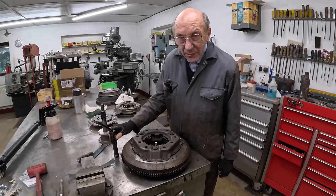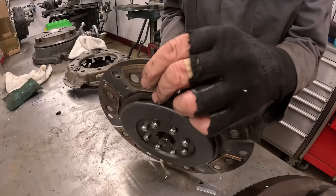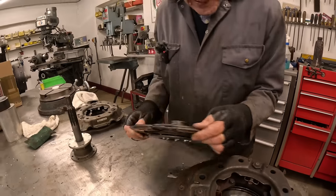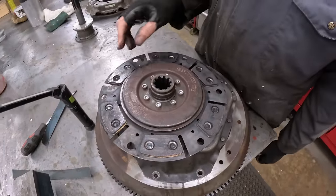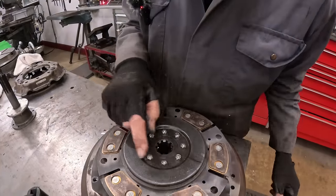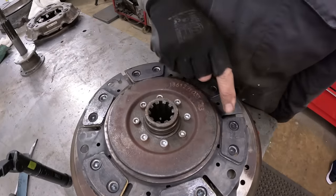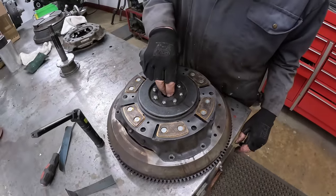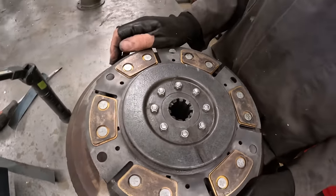And then previously we thought the clutch was slipping because it might be being held off by the spline. So we went to a load of trouble of making sure that was lovely, and it is lovely, so that ain't that. These came from America. They're sintered pads. So I took the lining off and put the sintered pads on, and they are about the same thickness as the original lining. But as you can see, look, this side is hardly used, where I think the oil might have been, and that side has had all the work. But I thought it might be possible that when you let the clutch out, that spline, if it's not absolutely loose, would be holding this side off. But I can't see it because that's absolutely beautiful.